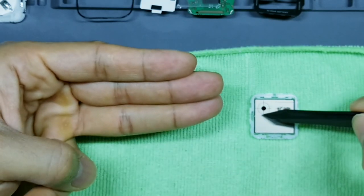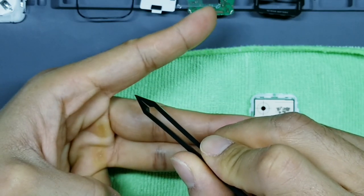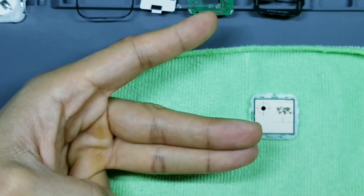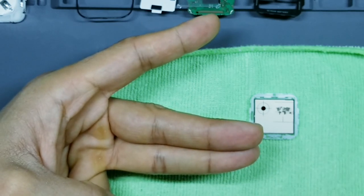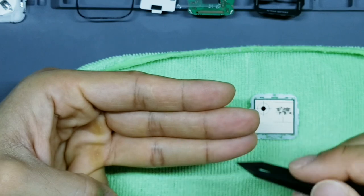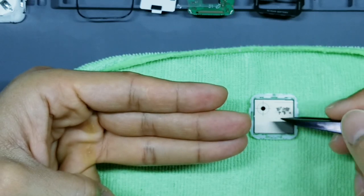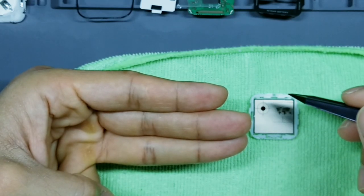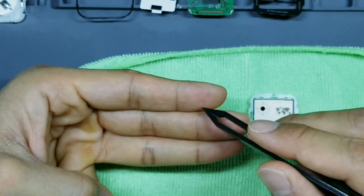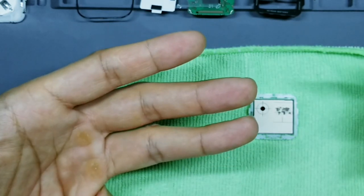What we're going to be doing for just this top portion is removing just the top layer and then replacing it with that polarized filter, but orienting the filter in a different direction so that way you get the black and white effect, okay? Now, if we go back to our hamburger analogy, the top layer on this display as it sits is actually a polarized filter itself. So essentially what you could do is you could just cut out this portion of the polarized filter, change the orientation as I'll show you later and reinsert it back, and then you will actually get that negative display effect.